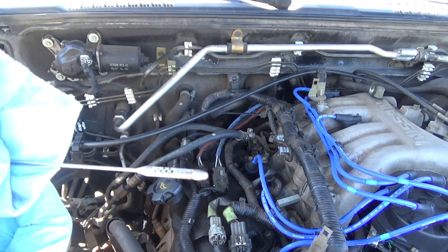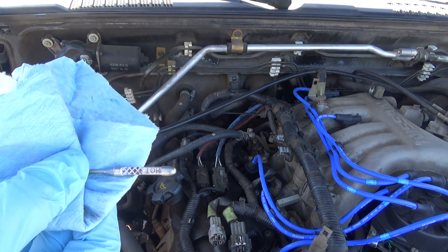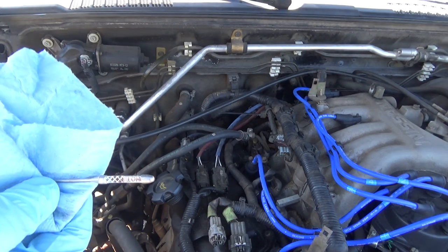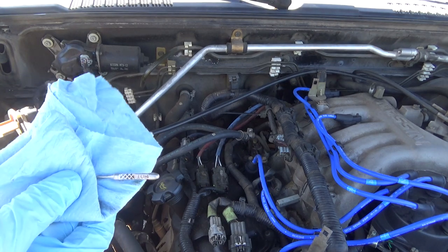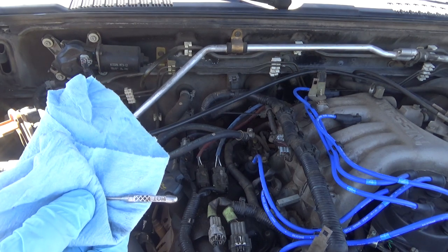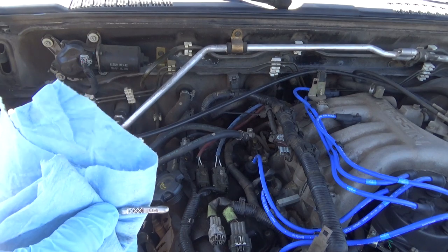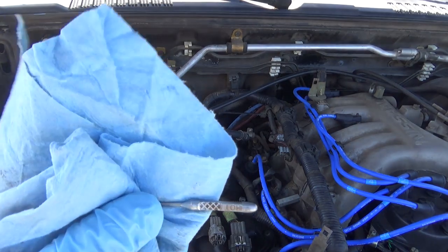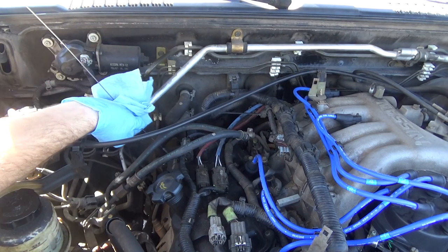We're actually right good. So you want to use the hot level because the truck has warmed up to temperature. You can see I'm just below the overfill, which was approximately 3.5 quarts, maybe a little bit more. It'd be different. Every truck or every vehicle is going to be different. You just need to look at yours. So use the hot side when your truck is warm or your vehicle is warm. And you can see that one is spot on. So I'm happy with that.